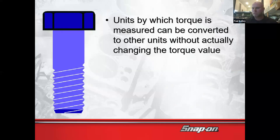So I want you guys to really understand the torque spec of a bolt wasn't just something that somebody made up, okay? If you wanted me to do it, I would overbuild it and that would cost too much money. So typically the engineers are going to try to make it more simple, cheaper, better for mass production. If they're saving a dollar on every car and Toyota makes millions of vehicles, it's millions of dollars. Kind of see how that works out. So don't take the torque specs lightly and understand they're clamping things together.